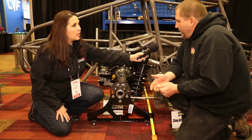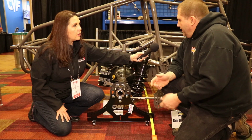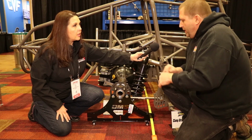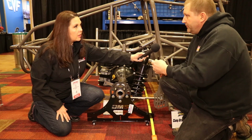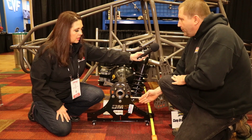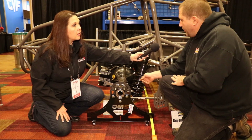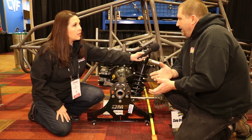So the next thing you want to do is pull the rear end out, and you can actually take these plates and leave them on the rear end. If you put a little riser in there and raise it up just a little bit, you can spin the housing 360 degrees, and you can actually watch the plate here walk back and forth. Then you can measure it, mark your tube, and you find, hey, I got a right rear tube that might be bent an 1/8 inch.